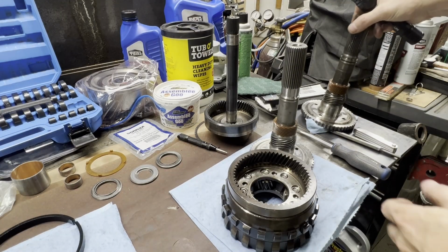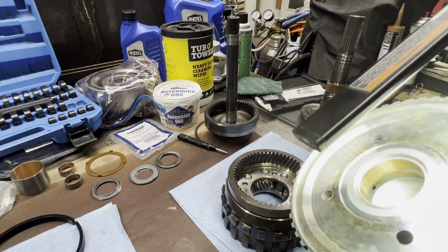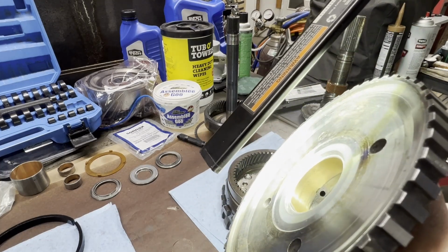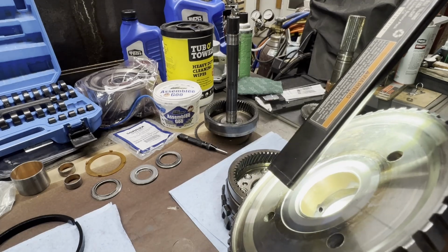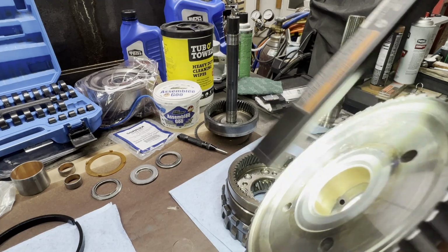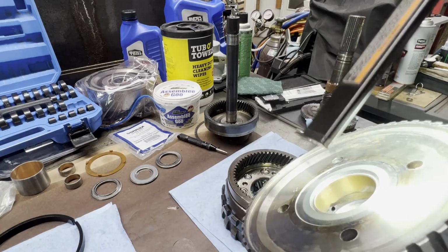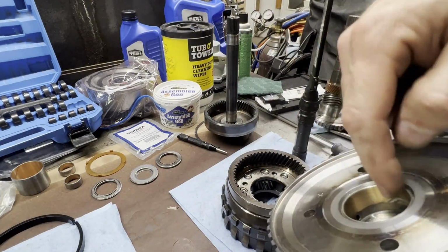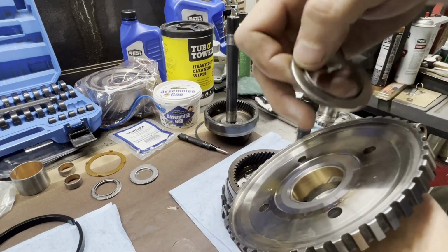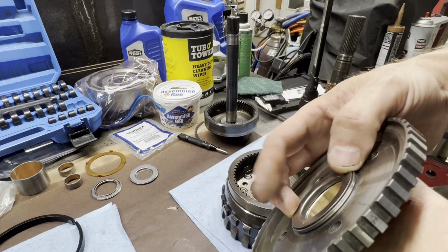The shaft I'm using is not that close. If I can get it turned just right, you might be able to see down in there, in that groove that I lined up over the lubrication hole. It's probably a 1/16 or even an 1/8 of an inch above the lubrication hole, which was causing my bearing to stick up more than I wanted it to. So when I tried to force it on down in there, it raised up on the bottom and caused it to get really tight. Now this one fits. I got it right on top of that ridge, but as you can see, my bearing doesn't touch. It's close, but it doesn't touch.